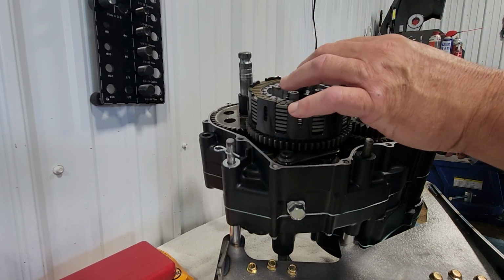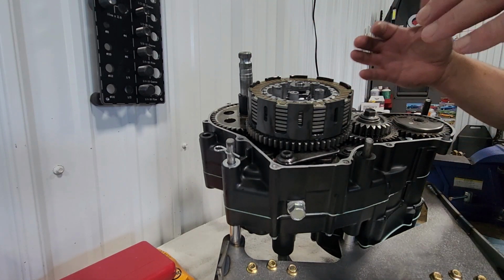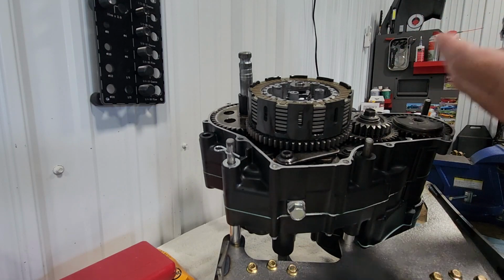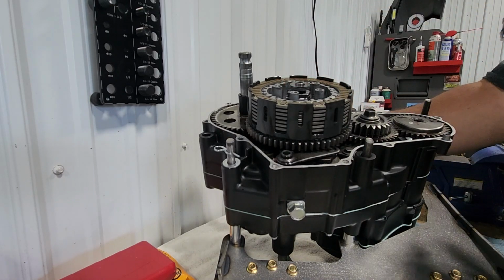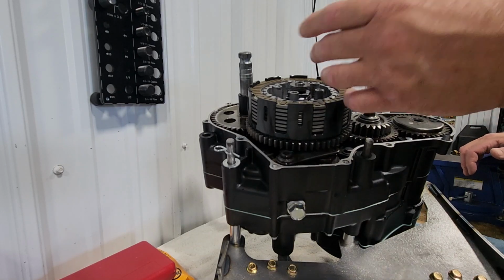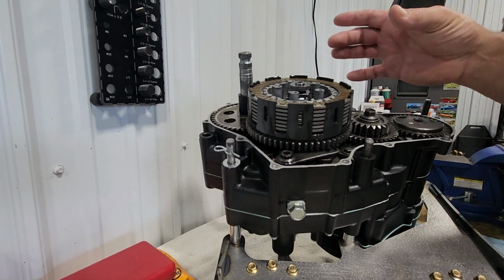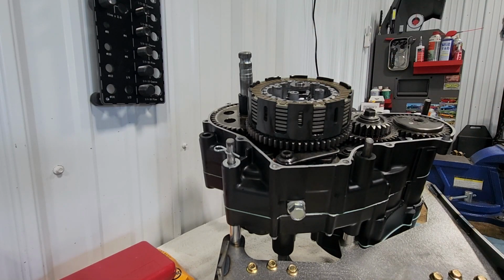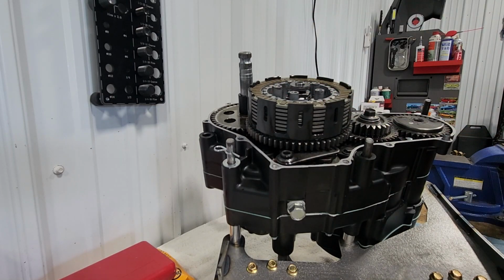In my case here, the rod was actually in the alignment of the actuator lever. There must have been possibly some rubbing on the case, or just catching the edge of the case. And I actually had to grind the rod down slightly. The rod is a 7.5 millimeter diameter. Took it down to about 7.1 millimeters in the bottom, I'd say 2 to 3 inches. And that allowed the rod to clear whatever it was rubbing, and now it's moving smoothly.